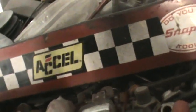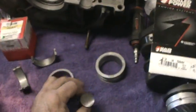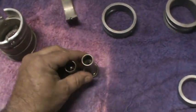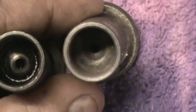This is a brand new one here — they're just real cheap. They're cheap in the process on these and the base is thinner. We were talking one day — they've always offered the reground lifters. You can see how thick the base is on this one compared to that one. We decided today it might be better to get the old German lifters refaced; people have been doing it for a long time and having good luck. You can also see the cup difference — this is the German one, it's got a much deeper cut for the push rod, and this one over here has a very shallow cup.